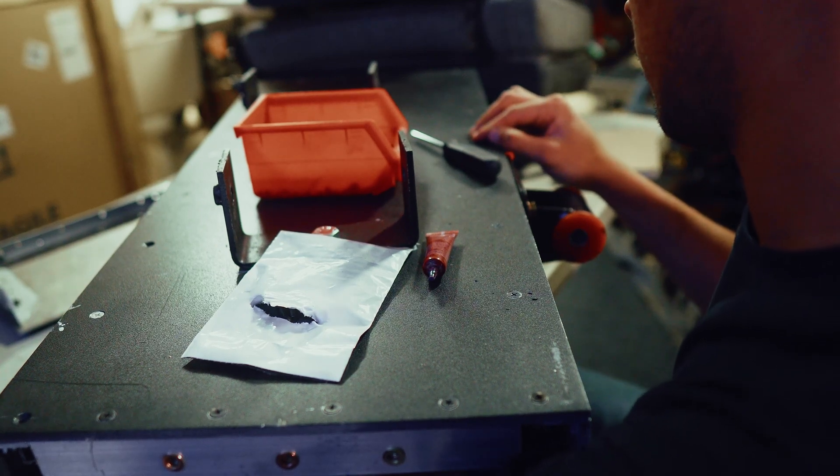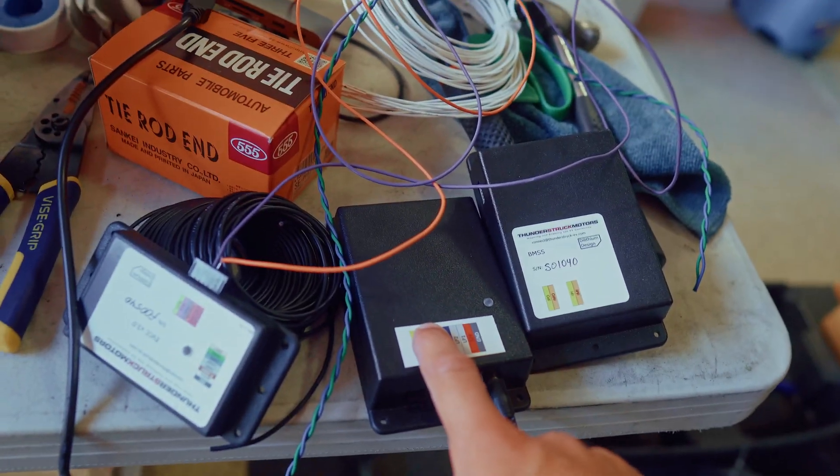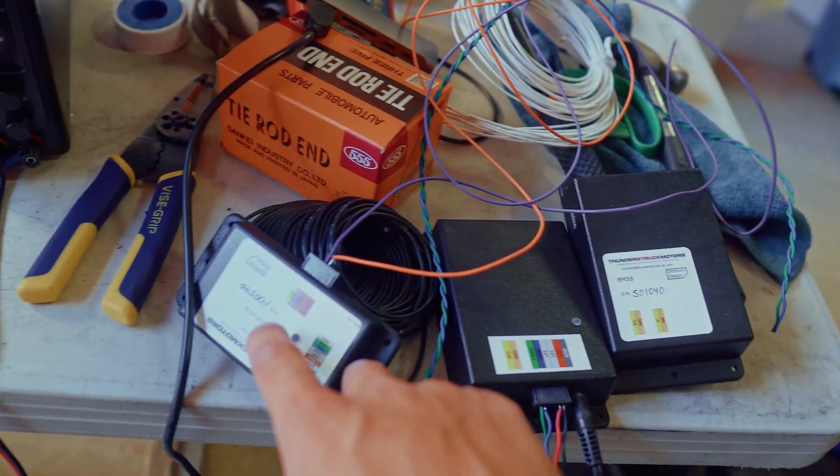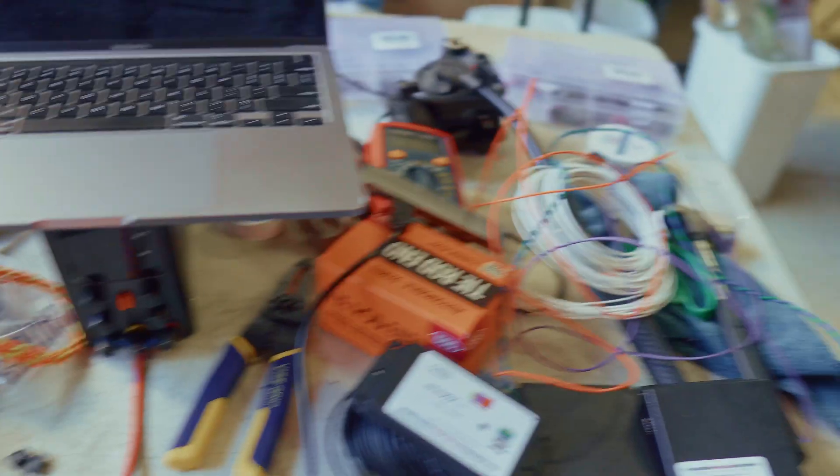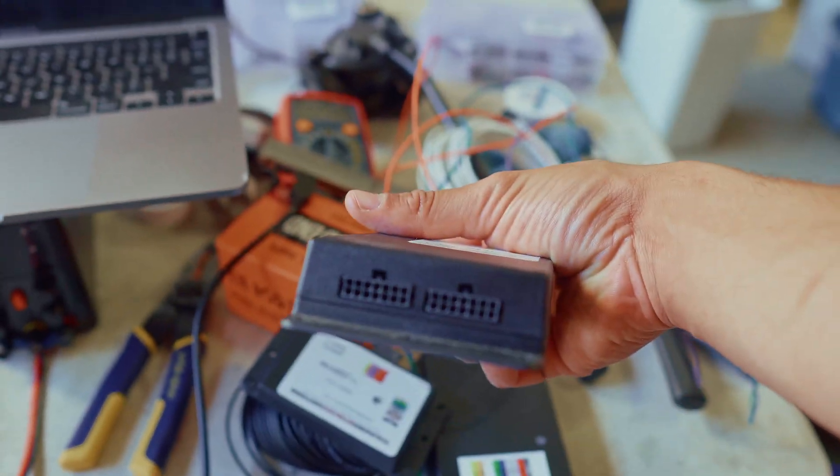Now that the boxes are all assembled, it's time to move on to wiring them. You can't just go and plug the batteries in directly to the motor — well, you could, but you might have some issues. Batteries need to be managed. They need to be balanced, they need to be charged, and they need to discharge at a proper rate. All of these things you have to consider, especially with lithium-ion batteries. To manage lithium-ion batteries in a high-voltage system, you use something called a battery management system. The system I'm using is a Thunderstruck Motors Dilithium BMS and BMS Satellite. With these two components, I'm able to monitor up to 48 cells. Our system has 30, so this is perfectly fine. The BMS monitors cells in groups of 12, each called an LTC.